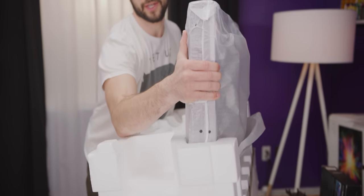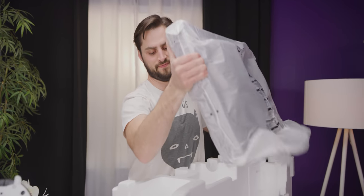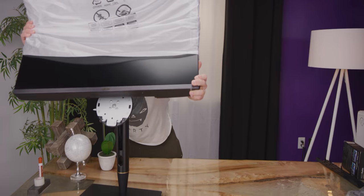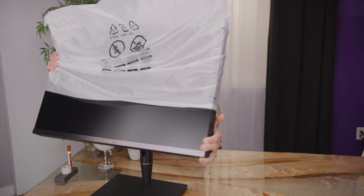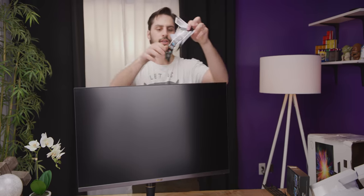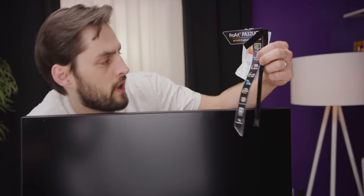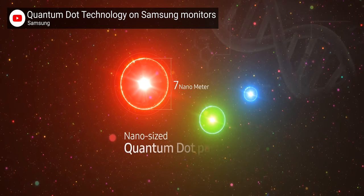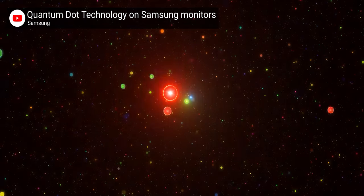I can already tell this thing is so thick, and it's because it's HDR. It's 32 inches and pretty big. You can see all these little badges showing off how awesome the color accuracy is. It's a true 10-bit panel — a lot of panels claim to be 10-bit but what they really are is 8-bit plus FRC, which is frame rate control. It also says Quantum Dot Technology, meaning there's a Quantum Dot Film in here that gives you really awesome colors, and you need all that color accuracy if you want a wide color gamut for awesome HDR.